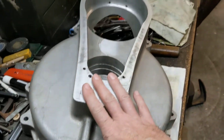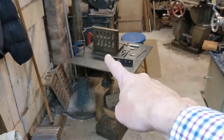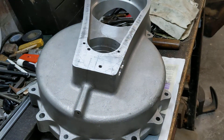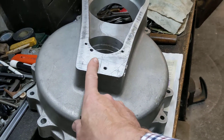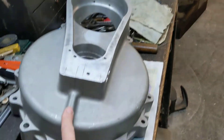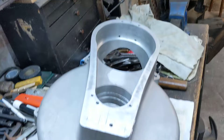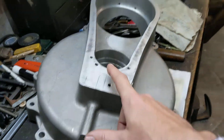That long drilling was a bit of a pain to drill because you put this on the angle plates, bolted to the angle plate, end-on, so you're drilling down from the top, and it clogs up the hole with swarf. It's a bit of a beast to lift it off, tip the swarf out, blow it out, and carry on drilling — so that's been a bit of a mission.